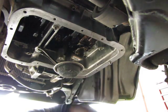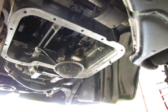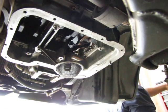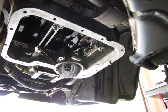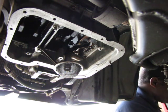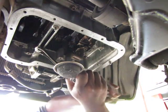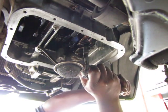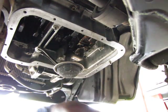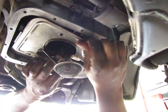And I probably should get a socket for that. I'm gonna have to get a 10mm socket extension for that. Okay, let's do this right. So yeah, snug that. Does not have to be crazy tight. But you do want to snug it and then give it like another quarter turn. Snug up, that one's tight. Now, I can feel confident knowing that I know how to put the bottom plate on correctly. Ta-da!